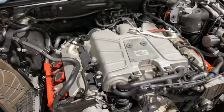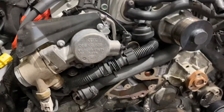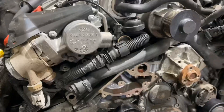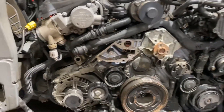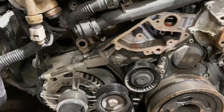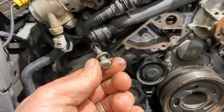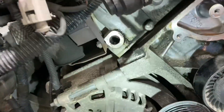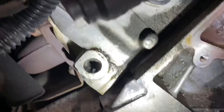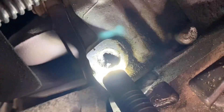There's a technical bulletin about the secondary air injection ports being clogged by carbon deposits. There's one port on each side over here. We removed this — there was a freeze plug in there covering the port. If you look inside the port, you can't really see past the first cylinder.